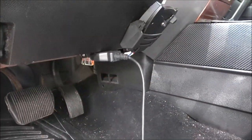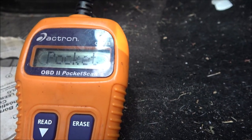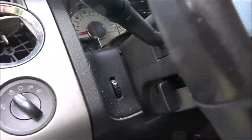Okay guys. So this is pretty simple — there's your OBD port. This is the code scanner; I don't know if you can read it, this thing's getting old, I need to get another one. It's a pocket scanner. So what you're going to do — you're going to find your little plug; it's usually underneath the dash, and in this case it's right there. We're going to go ahead and put the key in and turn it on.